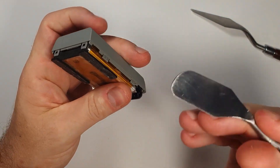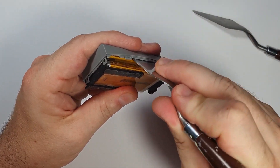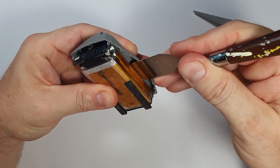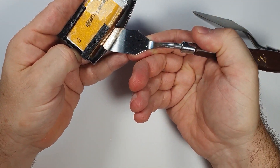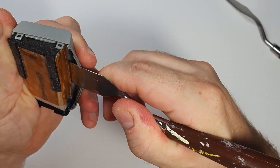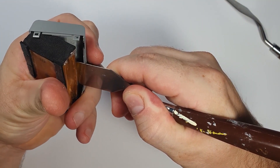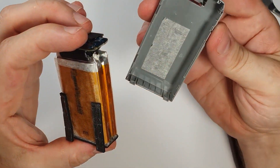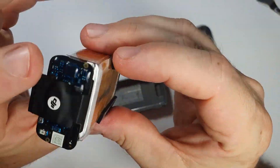To remove the cells from the lower casing I had to warm it up because there's double-sided tape under these two LiPo cells. This tape is very strong — you can see how the casing bends, the spatula bends. You have to be really, really careful when you do this. Someone had the idea that it should be impossible to remove, but once it finally pops, it's so satisfying. Then it's relatively easy to remove afterwards — here's the battery itself.